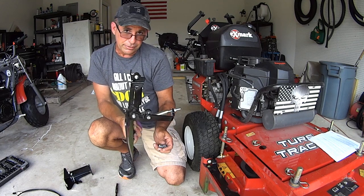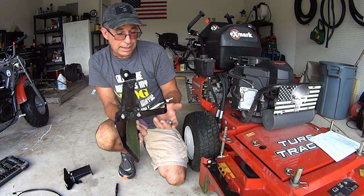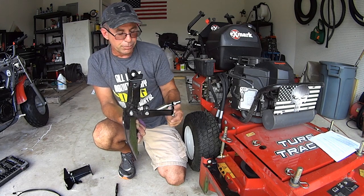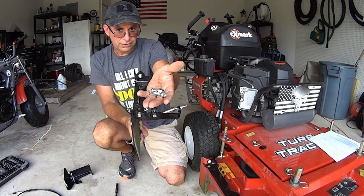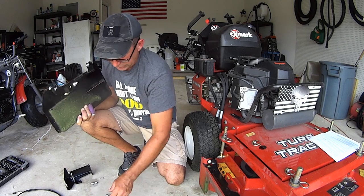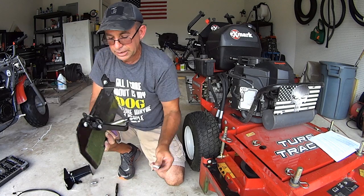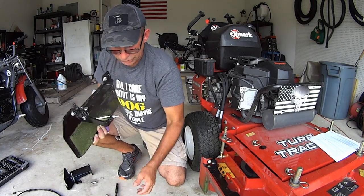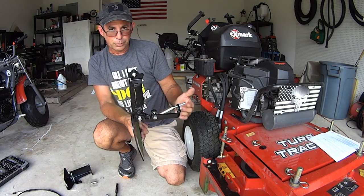The next day I called David at Grass Flap and I said, David, this is what I found out. This is what I got. Did I do something wrong? And he said, no, the hardware we should have included with your mower, with this model, we should have included more of these. The solution, which I agreed with, was to take the 2 3/8 that I don't need and drop them from the top. So the instructions said to use the 5/16s. The solution is use the 3/8s and you'll be fine.